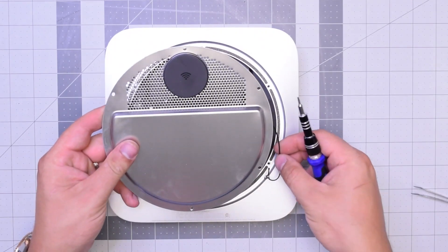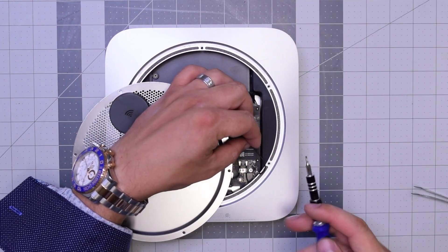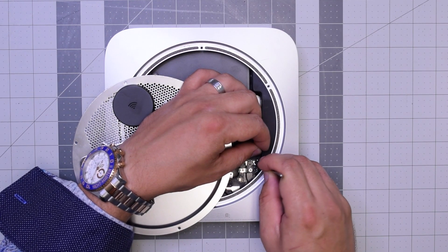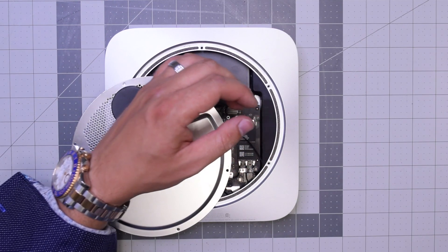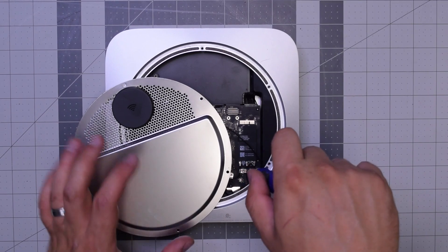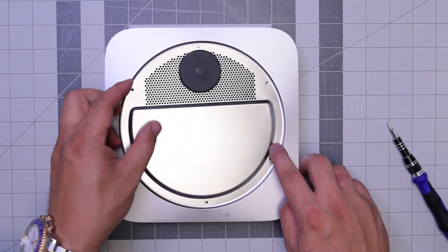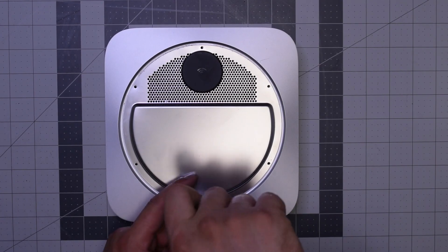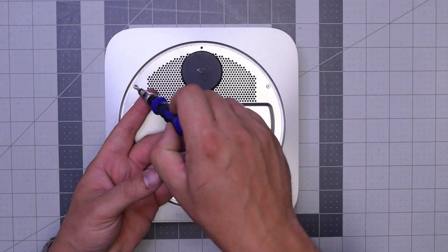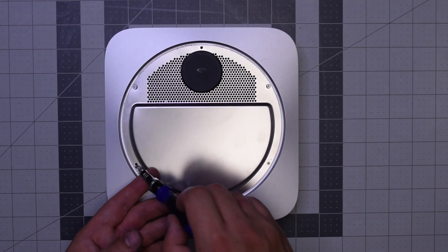Let's go ahead and reattach the Wi-Fi antenna. Go ahead and align it with the Wi-Fi and Bluetooth cord, then guide it in and make sure it pops in nice and firm into that socket. Twist it in and align that little retainer hole, because we're going to need to secure the last T6 screw right there. Then tuck that cable in a little bit. Align the Wi-Fi antenna cover and secure the three wider longer post screws first — these are the TR6 screws with that little safety in the middle — and then the other three smaller TR6 screws.